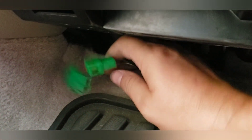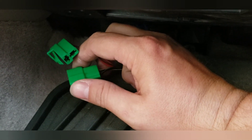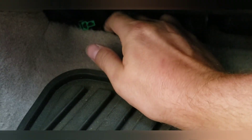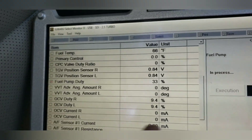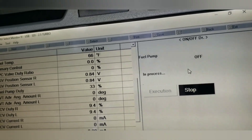I'm on the passenger floorboard here, and underneath the carpet are these two connectors. If you connect these together and turn the ignition key to the on position, it starts cycling all of the relays on the car including the fuel pump, and will effectively pump the fuel out of the tank. That's not the easiest way though, because I have a select monitor, and the select monitor is cycling the fuel pump until I hit the stop button.